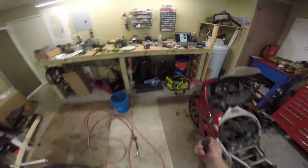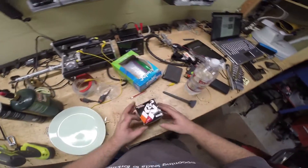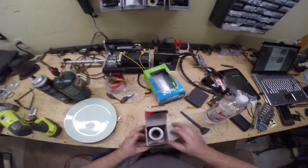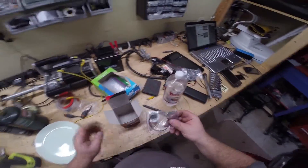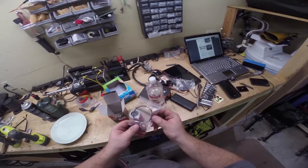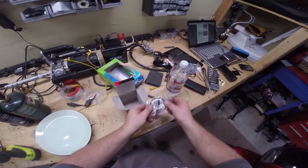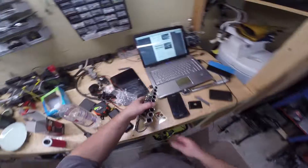We're just going to clean it off and set it aside. You can see it's graduated. The second thing you're going to need is this — KN564. This is a cartridge style filter. In addition to that you need to buy this separately; it costs a few bucks at the Harley dealer. It's new crush rings and a new O-ring for the cover.